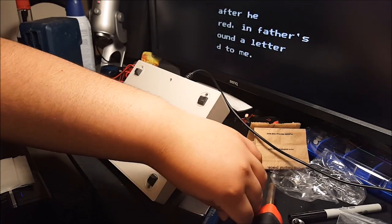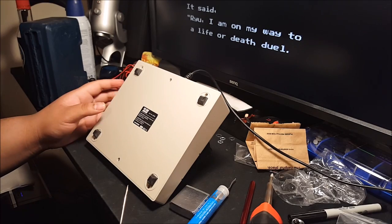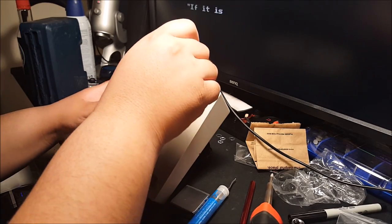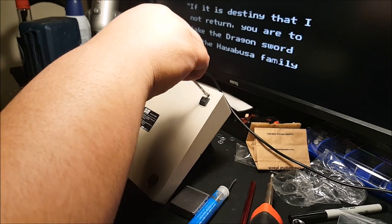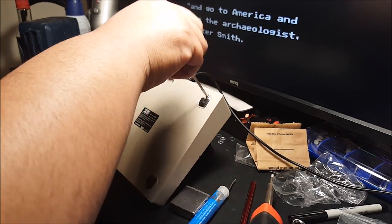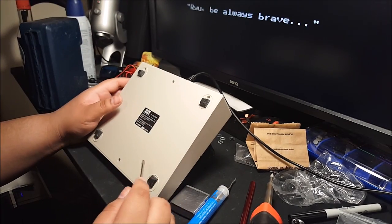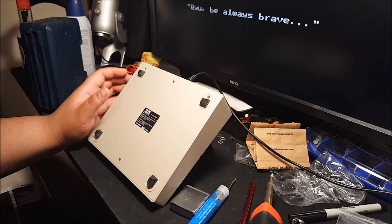In the back, you've got six screws. 1, 2, 3, 4, 5, 6. I'm using a flathead, but it's big enough. These ones aren't on tight either, about hand tight. When you do screw this on, you do not want to over tighten them. It is plastic, you'll round them out pretty easily. And there goes one. Oh, I'm pretty sure that fell under.